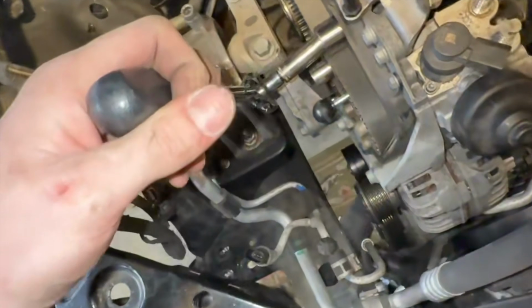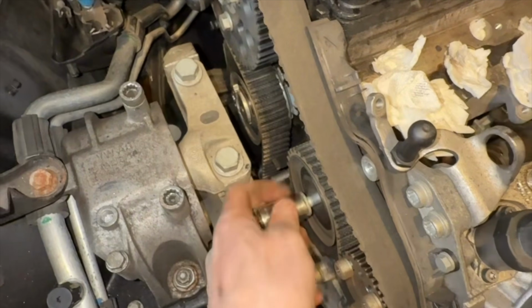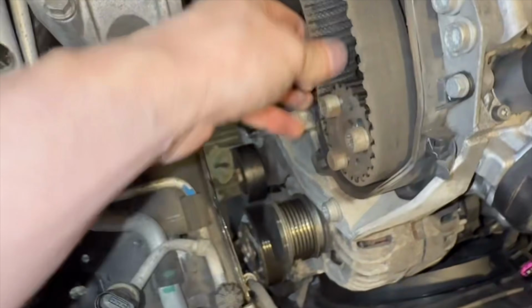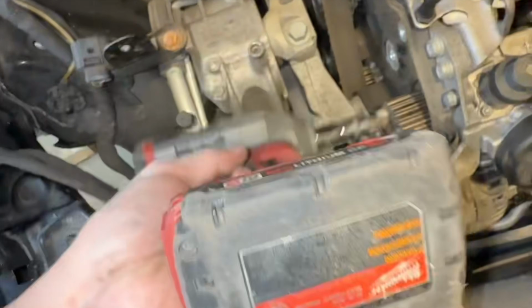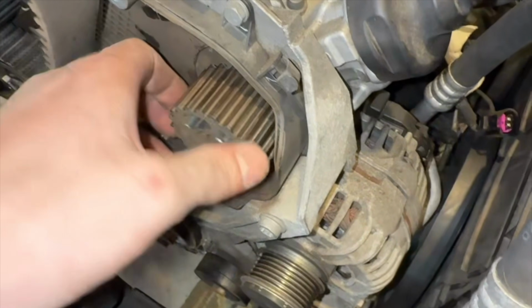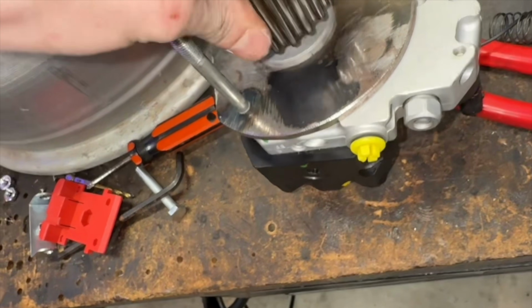Now I'm gonna remove one idler at a time until I get this belt off. All right, that's the first one. Still not enough. I'm gonna take this idler off. Is this a bad time to tell y'all I've actually never done this before in a common rail? Nice. Too late now. All tension seems to be off the belt, and I could hopefully just slide this right out. Guy on the internet was saying to loosen these up with the belt, but I was like, screw that. Those 3 off, I'm pretty sure this should, oh yeah. Here's my CP3 pump. Nice.